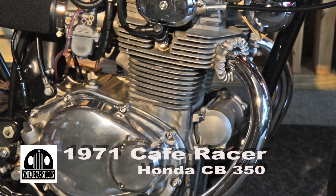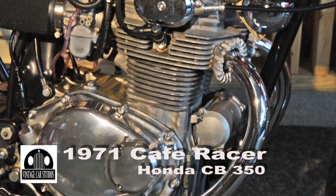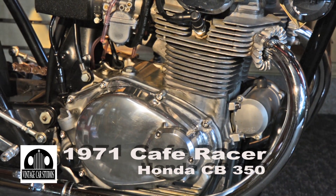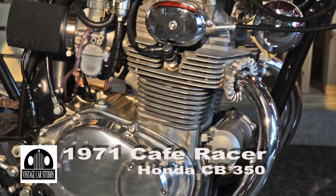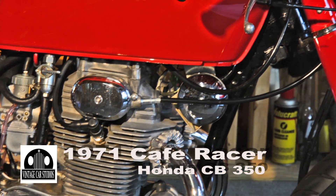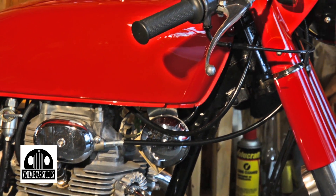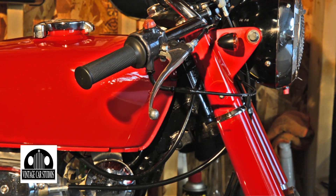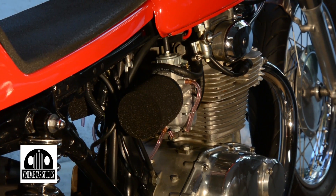What about the carburetors — did you have to do a lot of work on the motor to get this thing to run after you first bought it? I actually just did a good tune-up on the motor, changed the points and plugs and so forth, and did the timing. But I did change the carburetors — took off the original Keihin carbs and put Mikuni carbs on that are set up for a little bit more racier performance.